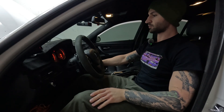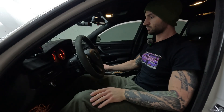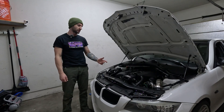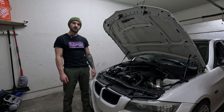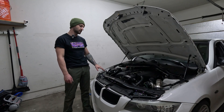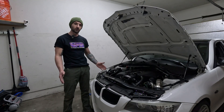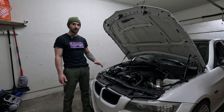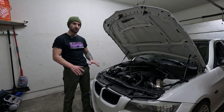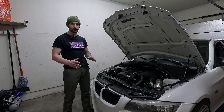The engine mounts on my car are only a few months old, so the movement you saw is a normal amount. The reason I'm replacing my engine mounts even though they're still good is because I filled them with 3M window weld. There's another YouTuber who did a guide on this — I'll put a link in the description. It's a nice modification because it doesn't introduce too much NVH, but I'm getting a little older and any bit of vibration kind of irritates me, so I'm going back to stock.